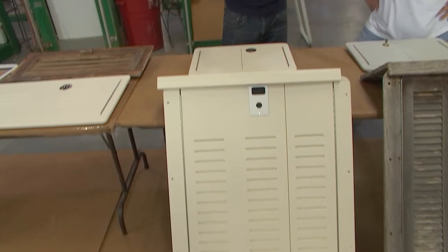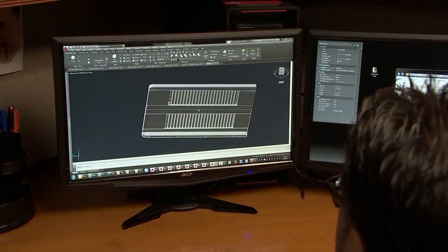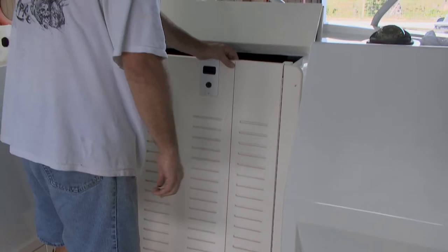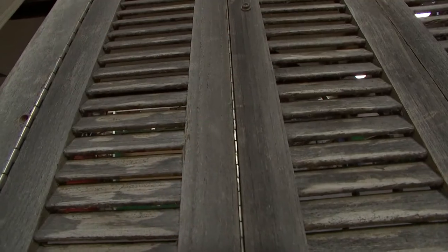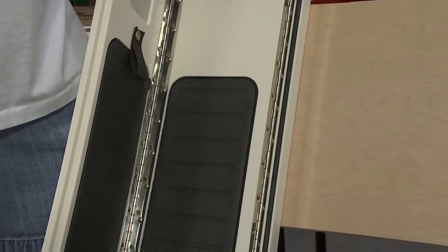We took the parts and were able to put it up on our digitizing table. We had engineers trace around the entire outside shape of the door and the hatch, they were able to make 3D models, and then cut on our CNC routers to make finished King Starboard replacement parts. A lot of boaters have experience with louvered doors — at night, if they're sleeping in the cabin, mosquitoes can still get in. What did you do to enhance this? We actually milled and integrated screens behind the louvers to eliminate mosquitoes being able to get down into the cabin.